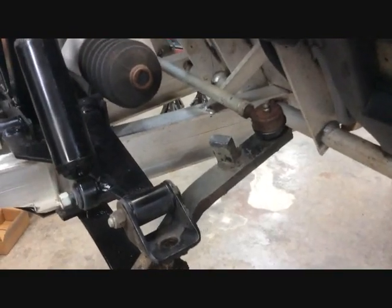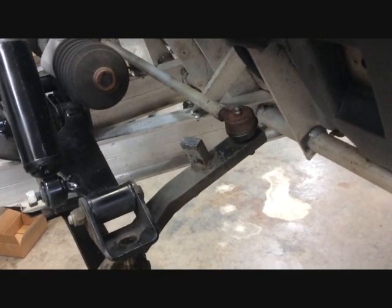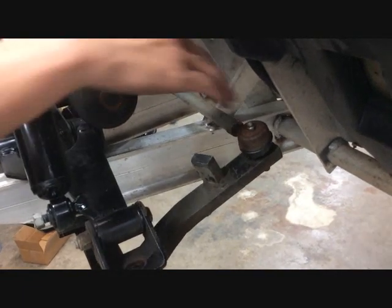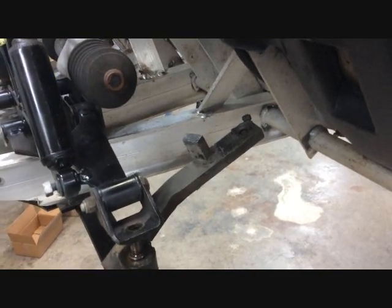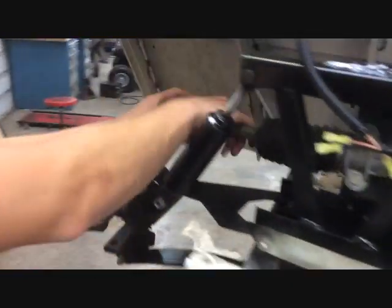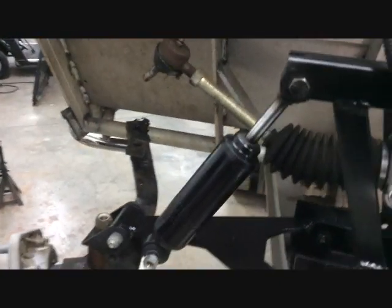This cart's a newer model that has straight hole tie rod ends. You can go ahead and tap them with a hammer and then pull the tie rod out and remove it from the car. If you have tapered tie rod ends, you might need to use a tie rod lifter to get these off the car. Then pull it off of the main steering arm on the passenger side.